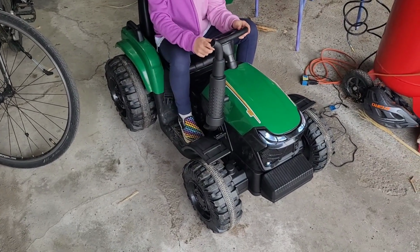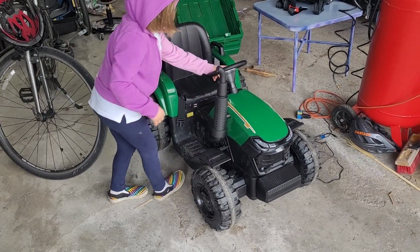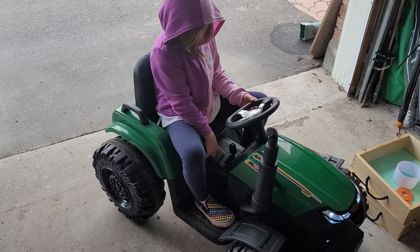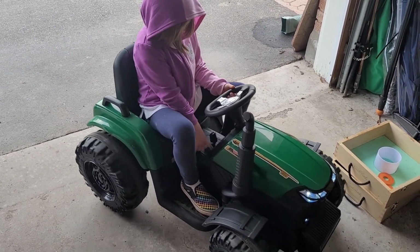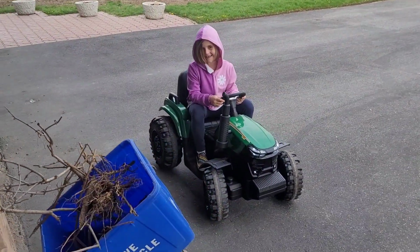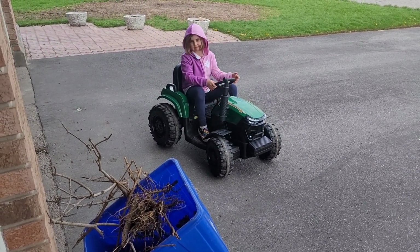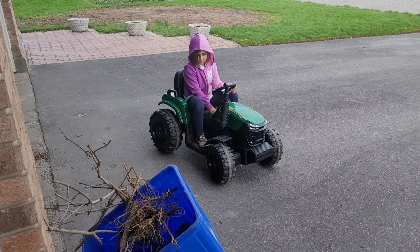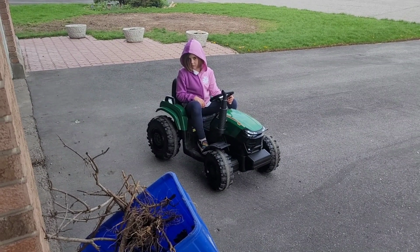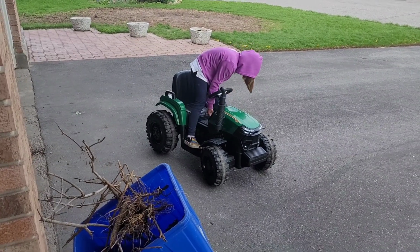Anyway, does it go in reverse? Yep. Oh, that's interesting. Okay, all right, we'll investigate this further and report back. Careful. Okay, forward now. Put it in forward. Nothing in forward. Now try it in low speed backwards. Nothing. So it works in high backwards, not in low. In low, nothing. Okay, all right, let's take it apart, see what we can figure out.